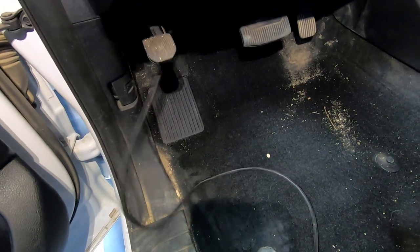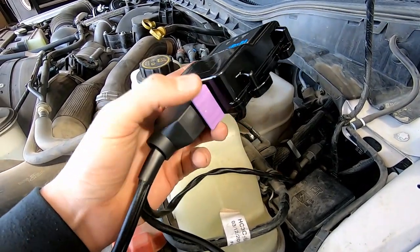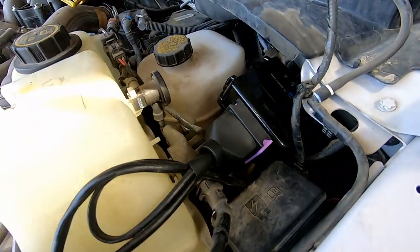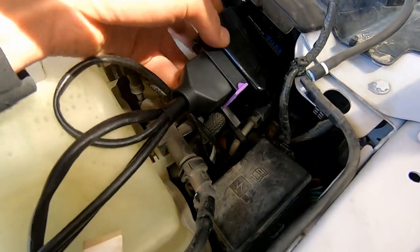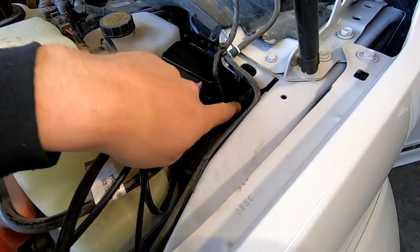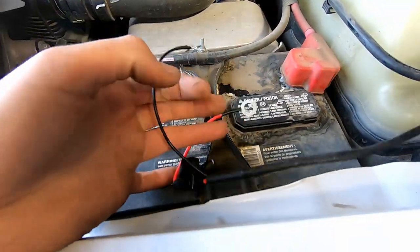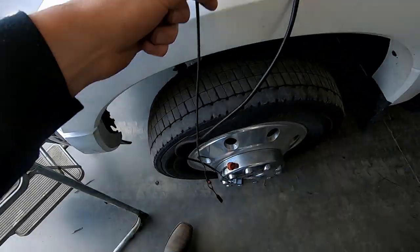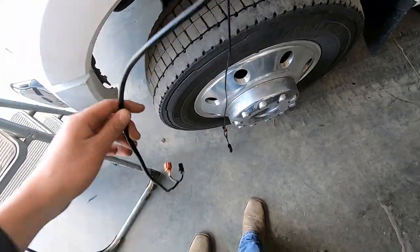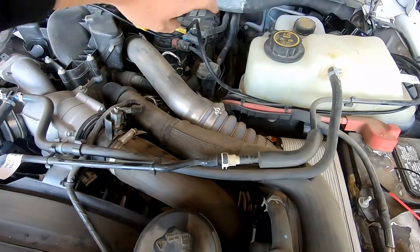Once the wire's in, pull the slack into the cab and tie it up under the dash when done. To plug in the cab switch connector, just plug it in and push the purple tab in — it'll click and lock. Set it roughly where it's going to sit. One line is already going to the cab, another goes to the battery right there, and then we have the two remaining harness lines.